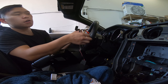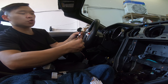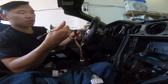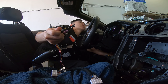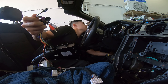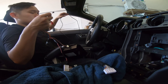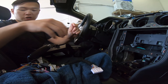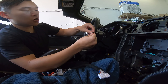If you have a premium Mustang, you might have a Bose sound system or Bang & Olufsen sound system, and you might have to connect this amp control connector. In this harness we don't have that; in the main harness there's nothing to connect it to. This OBD connector is going to connect to this OBD connection we have at the bottom — we do provide you this connector. It goes to the bottom of the car. We put it behind the vehicle, underneath the steering column, and it comes out from right here. You're going to make that connection right here — OBD connector goes to this connection — and what this will give you is your RPM and speed.